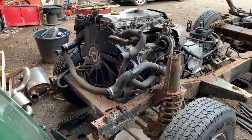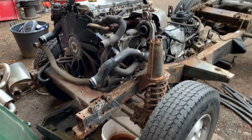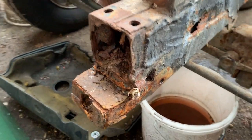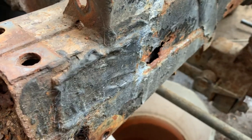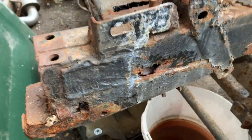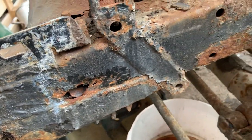We've bought a new Richards galvanized chassis and it's about to be transferred over with new components. Down here, this is the front nearside dumb iron, which you can't see a lot of when the body's on, but there's absolutely nothing in there to weld to. It's had a bad repair at some point in the past — we've knocked a lot of it out with hammers. It didn't have a particularly short MOT when it came in, and repairs have been bodged and disguised over the years.